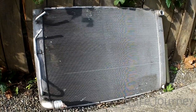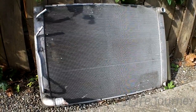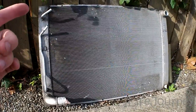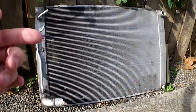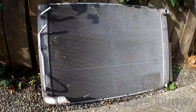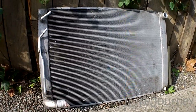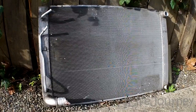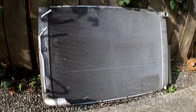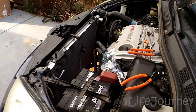This is the old radiator that came out — it doesn't look in that bad shape. It's an all-aluminum design, but from my research these Toyota radiators will leak in this corner over and over again. So the replacement uses a plastic end cap design, and it includes both radiator fans. It's basically a drop-in design, but let me show you some of the issues I had installing it.